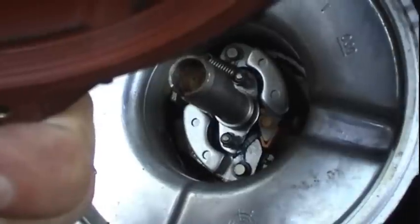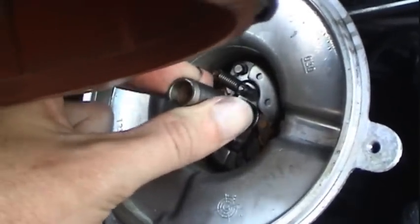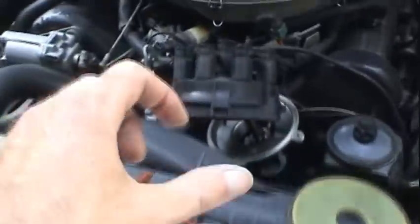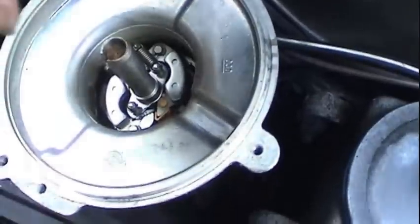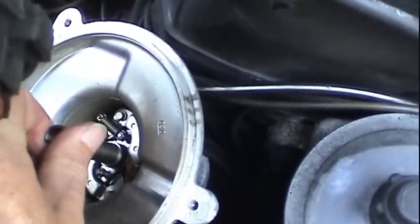And looking at a lot of the manuals and service information, some of these cars had two springs, some had one. And the other thing is the way this car is designed, there's no way to advance the timing just with this mechanism here. You cannot set the timing on this car by turning the distributor like you can on the 72 Lincoln, which just has a vacuum advance and centrifugal advance. The timing on this car is controlled completely with the EZL module, with various inputs for coolant temperature sensor and throttle position, as well as engine vacuum. All this does basically is sets the basic timing, and then the ignition module takes over from there. So that's not going to be the source of my high idle problem, unfortunately. Maybe replacing the CPS will help with that, but certainly this seems to be okay here, like it is.